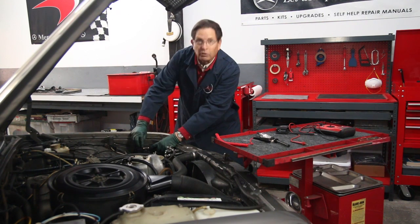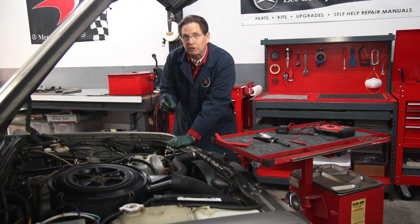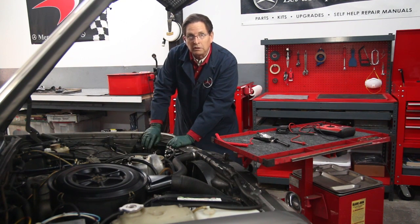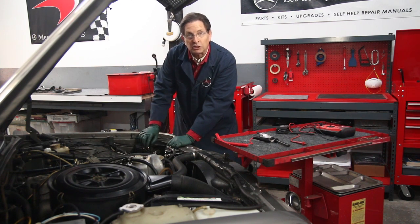You also want to look for corrosion at the screw heads and tighten these screws down. If this fuse is blown or burnt, it probably means you have one of the glow plugs shorting in the engine and that's why it burned out. If it's cracked, that may be the only problem, and all you have to do is replace the strip fuse.